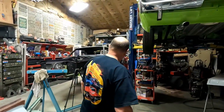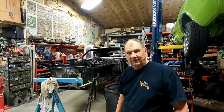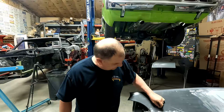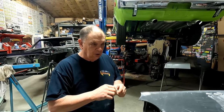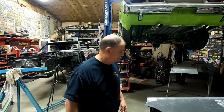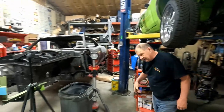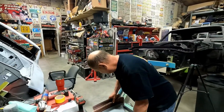Yeah, the welder just kind of whistles and pops. You can't weld rust. No, it wasn't. This was on the new metal. It would just bead up. It worked okay, it wasn't like it was just perfect. It would whistle and glow like I was putting a bead of liquid, and then it would be all right, and then it would do fine for a while. That sounds weird. I've never seen my welder do that. Well, we'll have to try it. I'll make sure I turn it on. Yeah, I turned it off. Oh, okay. I was thinking maybe I don't have the gas on. If you don't have the gas on, it just kind of sounds like static.